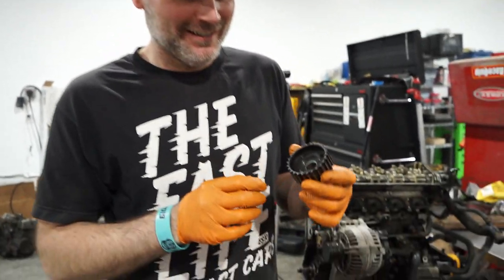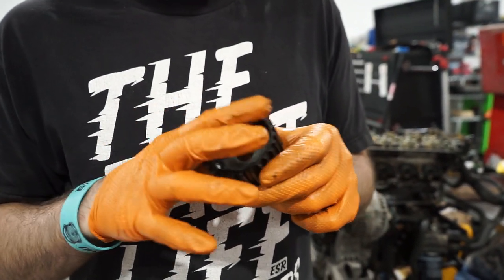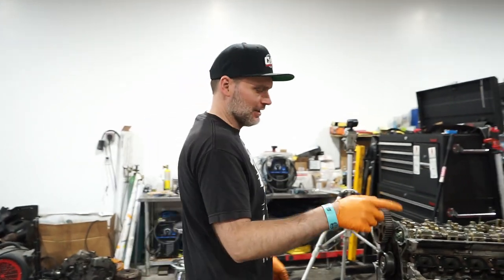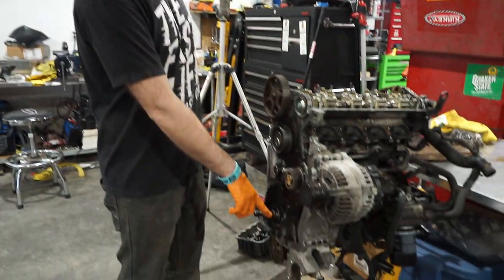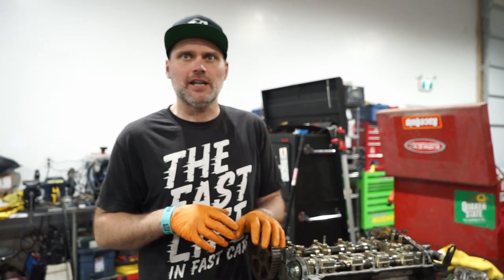First thing is — you've got to look at this before you put it back on. It's damaged. The keyway's half sheared off. So this becomes a failure — the whole engine's out. Ben noticed that was damaged. So we've got a new sprocket coming tomorrow. But until then we're going to just start putting the turbo gear on now and getting into the fun stuff.